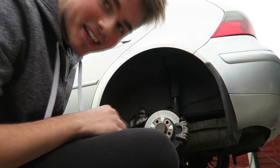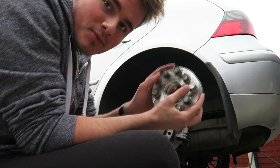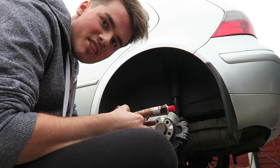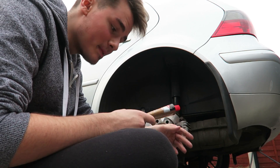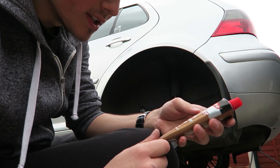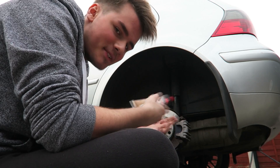What do you need to do this? Alright here you are. Obviously you got your wheel off, you got your spacers ready. You want to stop it from corroding - it sort of meshes together so it makes it impossible for the spacer to actually come off and you don't want to be damaging it. So I bought some multi-purpose grease, I'm pretty sure it's copper grease - anti-seize, that's the word. It stops this from seizing to this.